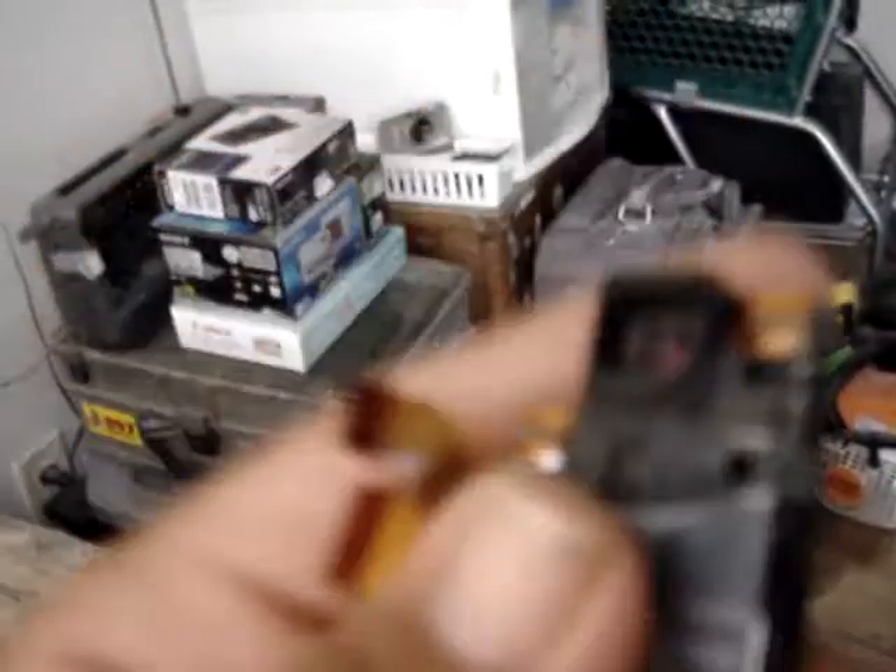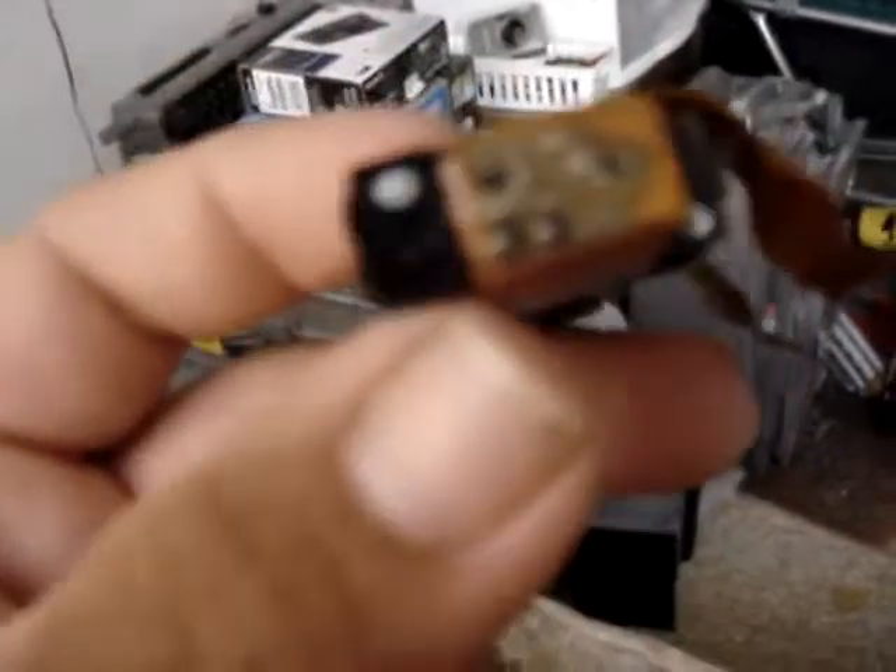That, as you can see, there's a little tear in the cable. Yeah, so I tore the cable to the lens assembly, so the thing was reading a lens assembly error code.